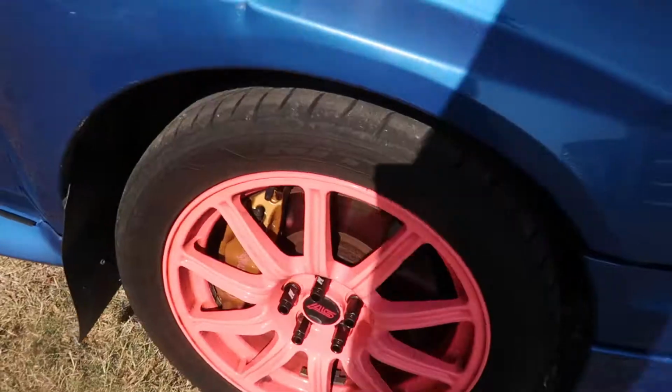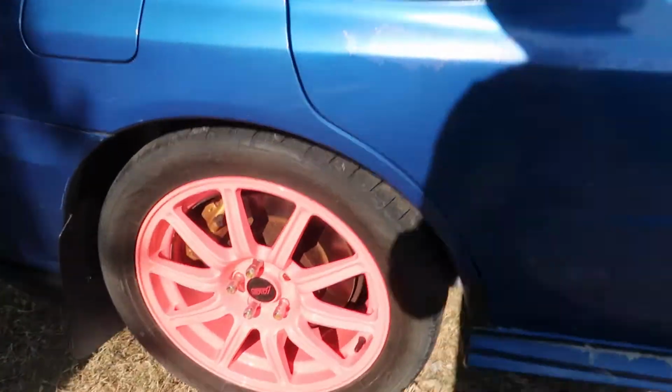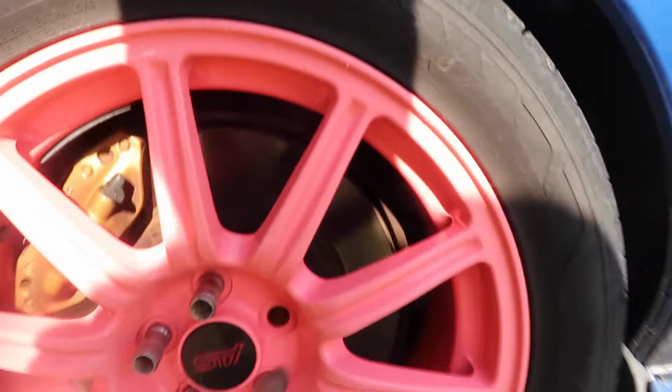But we got the new lug nuts on, all except for this backside, which is still silver and missing a stud. The next time I get paid, I'm gonna go ahead and get the wheel stud. I need to do an up pipe gasket because I don't know if you can hear it, but I can hear it and it's annoying, the up pipe is leaking from the gasket. It's very obnoxious and I can't wait for it to just sound normal again. What else do I need, Kenny? Need to get my storage building so I can get those end links.